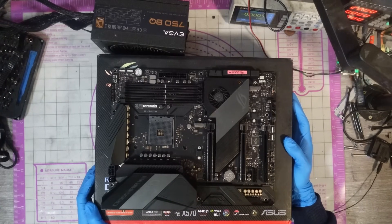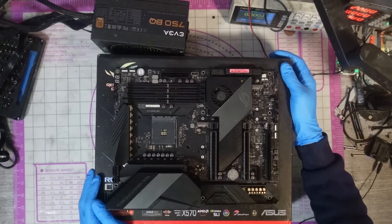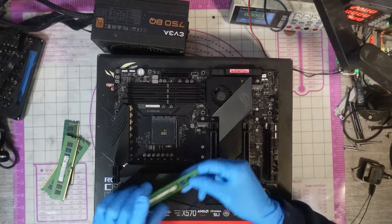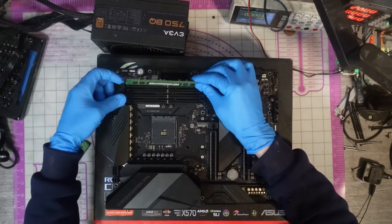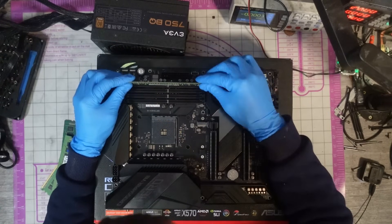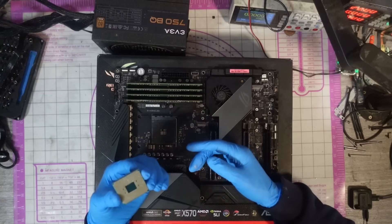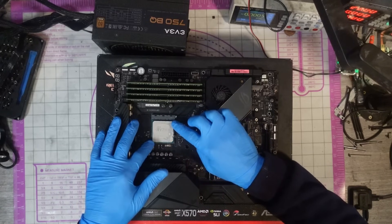I could do with a new motherboard anyway. If I can get this working, great — I'll actually get an upgrade because mine's just a cheap motherboard and I'm kind of regretting it. I've got everything I need to hook this up as a test rig. I've got a 750-watt EVGA power supply — that's a known good power supply. I've got 32 gigabytes of RAM, all known good modules. I'm going to hook up all four right now, and if it turns on and doesn't post, I'll try one RAM chip in every slot. I've also got a Ryzen 5 5500 — that's perfectly fine as a test CPU — so I'm going to pop that in there.